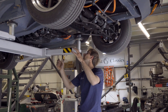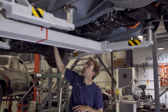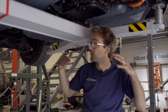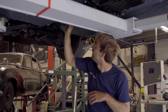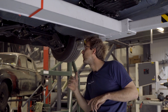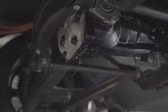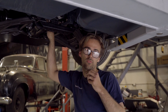We've got it in the transmission tunnel. We've got a custom CV style prop shaft under here, which we moved to CVs because we couldn't get the angles perfect - CVs give you a bit more leeway in terms of misalignment. So yeah, custom CV prop shaft with billet aluminium adapters. And we have a recently fitted LSD from a Subaru - it's a torsion style LSD, which is what you want with this sort of power.